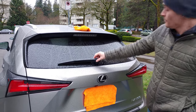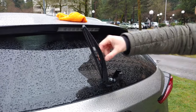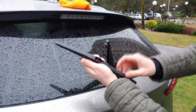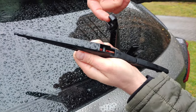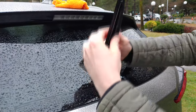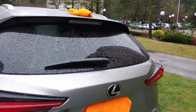To replace the rear wiper, first you have to lift this plastic cover, then lift up the wiper and twist it like this and it will come out. It's held like that — you can see this small piece here which goes right here. Put it back. Do it exactly like that. Done.